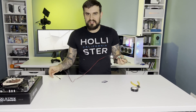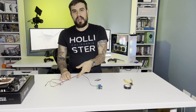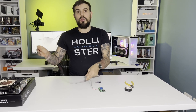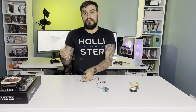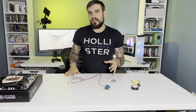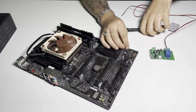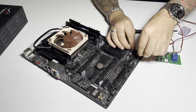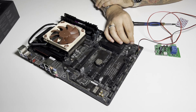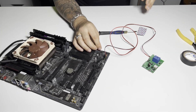If you wanted to use this in your PC case and still wanted to use the functionality of your physical switch, I'd use a Y connector to connect this side along with your other PC power switch connector, and then both cables go into the motherboard. You can do some soldering if you want. Because I'm only ever going to be using that server when there's Wi-Fi available, I'll always be turning it on via this, so I don't need to modify anything else or use the physical switch. The polarity doesn't matter either. So all you've got to do is place that in there, and then it's ready to be used — obviously providing that you plug in USB power to it — and then you download the app.